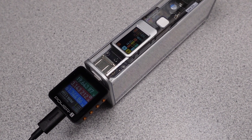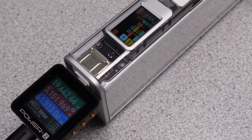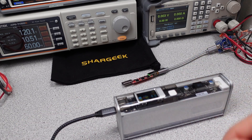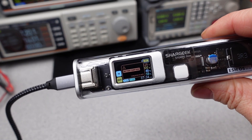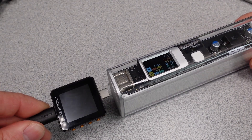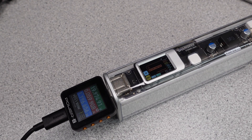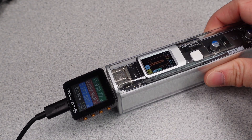Charging time hit the claim dead-on at 1.5 hours to full charge. It starts at 65 watt charging and holds that for almost until the power bank is fully charged — after a 10-minute break in the middle to cool down after about 30 minutes. If you left it to charge, it would sit with a warning on the screen about overheating and wait for you to clear it to start charging again. This isn't so great; it can charge in that time if you hang out with it and give it a break halfway through. The cell capacity did always show fairly accurately on the display. Stating the capacity honestly would let people calculate real use times instead of expecting 72 watt-hours and getting 57 usable.